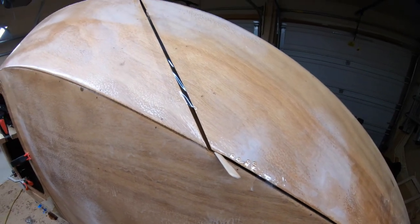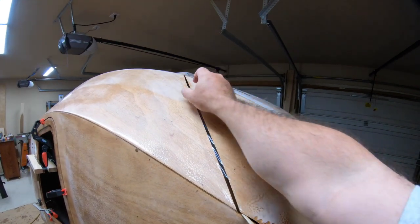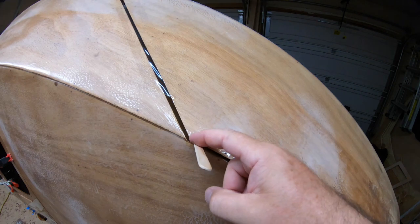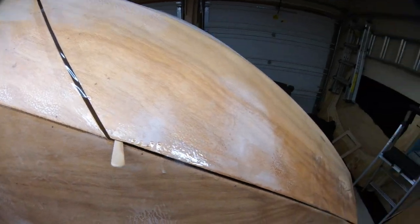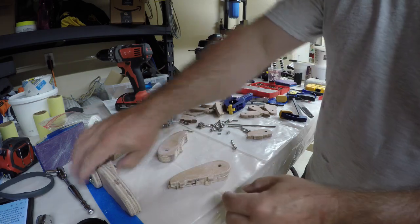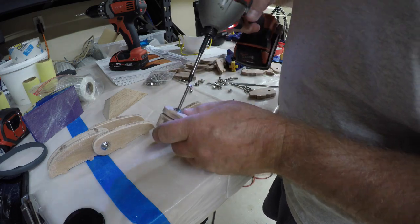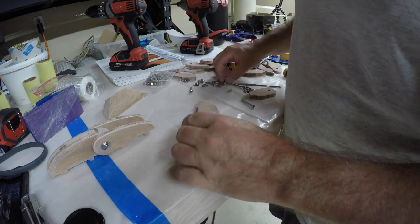To do the hinges for the galley hatch, I used packing tape and popsicle sticks to hold the hatch in position. I assembled the hinges temporarily so I could test fit them on the camper and make adjustments. Since this means that each hinge is slightly different, I marked each one with where I had fitted it: left, right, upper, lower, top, and bottom.